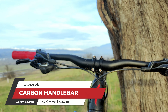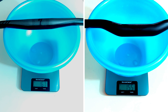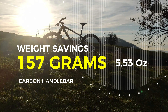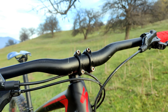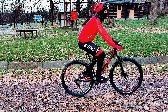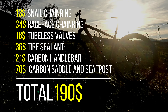The last thing I replaced was the handlebar. I purchased a carbon handlebar from AliExpress, and there's a YouTube video where you can see me replacing it. The original handlebar weighed 312 grams and the new one weighs 155 grams, lowering the weight by an additional 157 grams. A big advantage is that the carbon handlebar can flex, absorbing shocks and bumps much better and reducing hand and wrist pain. I totally recommend this upgrade even if you don't do it for the weight. The handlebar cost $21.